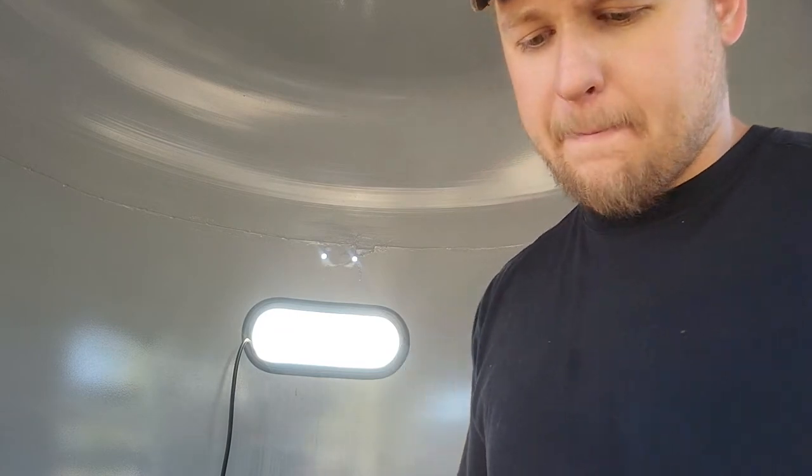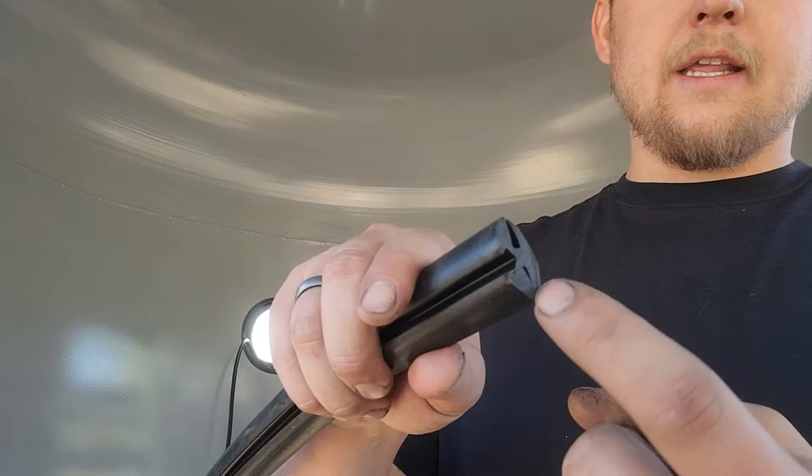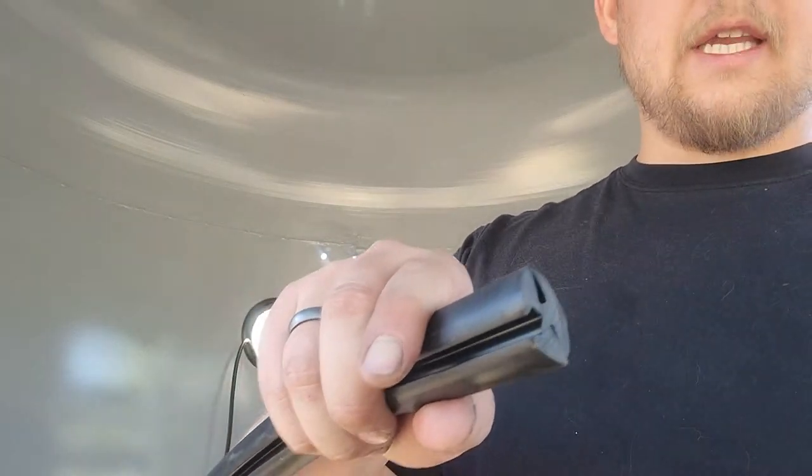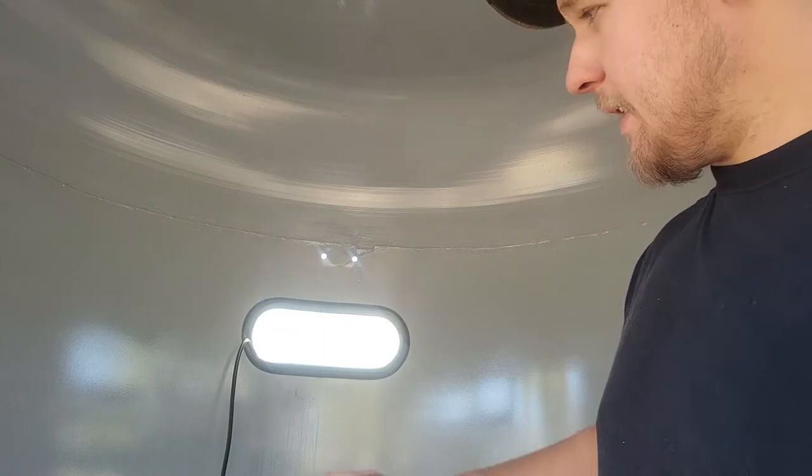They sell some tools — you can find them on Trim Lock's website. I believe that's the product I'm using: Trim Lock. There aren't a whole lot of different gasket makers for these gaskets anymore, but there are some tools that help get these gaskets in easier. There's basically a hook and a plastic pry bar type thing that help you get the panel and window sections in. I've already put my window and gasket in; what I'm working on right now is the locking bead, and that's proving pretty difficult.